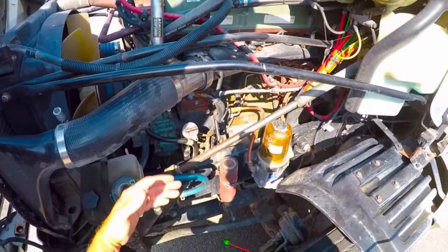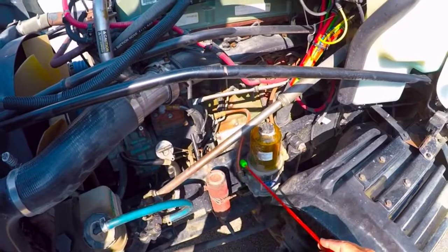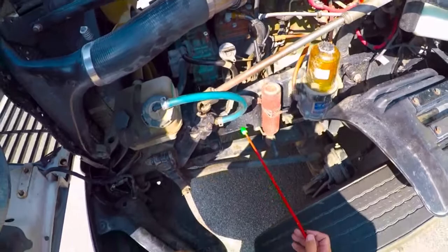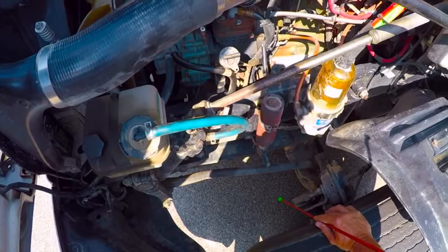So I've finished with the engine overall. Now I'm going to work towards me and tackle a few different systems, starting with my frame. This long channel frame rail is the main frame of the truck, and I just want to check to make sure there are no signs of any damage, no cracks, nothing twisted, dented, or bent. All looks to be good there.